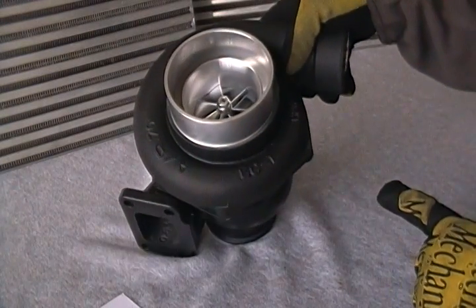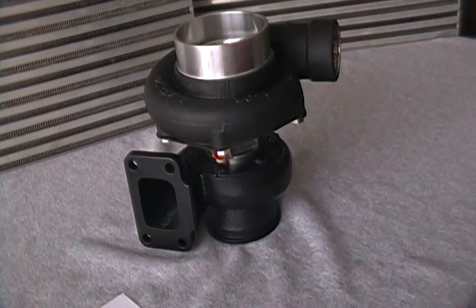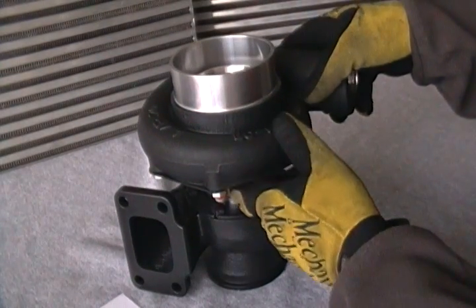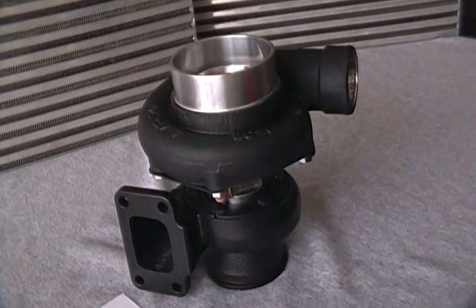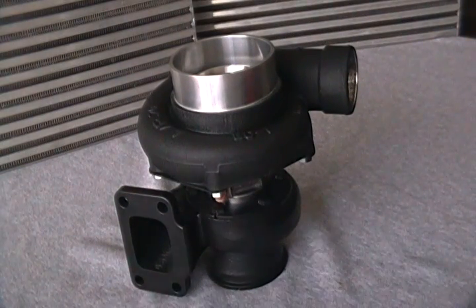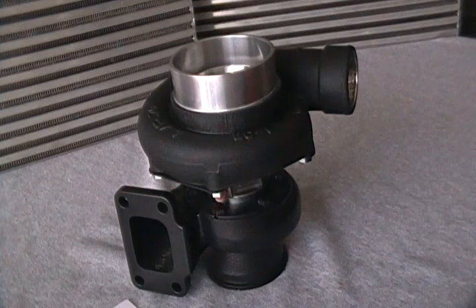This level of effectiveness is created for vehicles that really want higher thrust loads, are higher RPM based, and still want durability and reliability. The effective pressure ratio for this turbocharger is going to be from 18 to 34 pounds of boost pressure — about 2.0 to 3.4 PR if you look at it from a compressor map point of view. This is a great way to run higher boost pressure while still staying in its effective range and remaining usable and reliable.